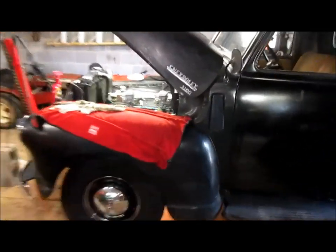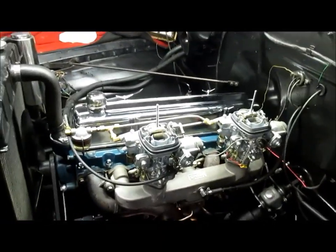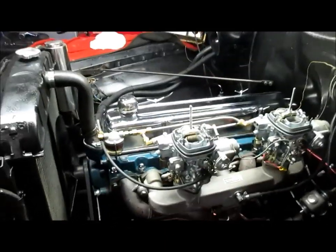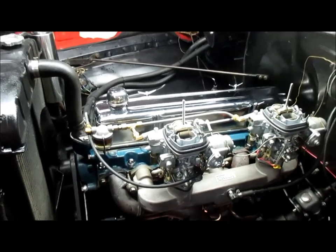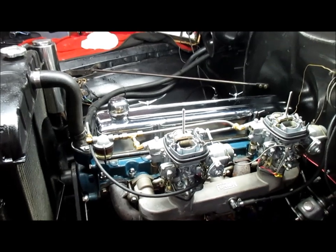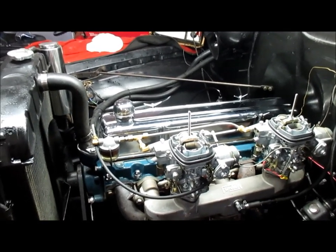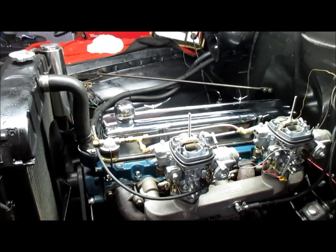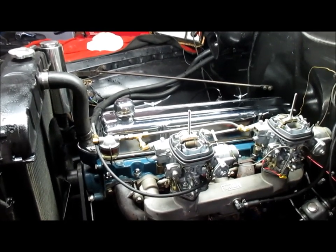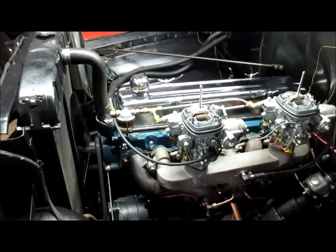I got the valve cover back on. And I used the ultra gray, and it says to let it cure for 24 hours before you put any oil in it. Now, I didn't do that for the rear end, which is not leaking. So I probably went about 5 hours before I put oil in that. So I'm going to wait a full day till tomorrow on that.